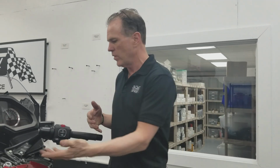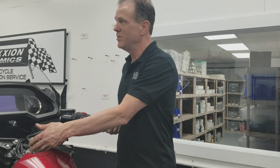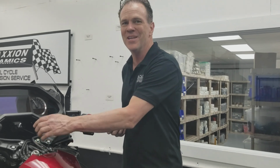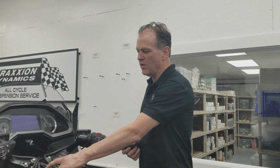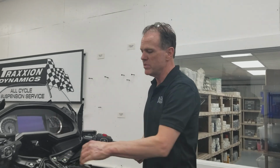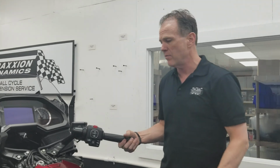Normally, the whole fork and front suspension is transferring all kinds of load and shocks and jars into the bearings, and the torque is twisted there. And so that's why your steering bearings wear and loosen up over time. This bearing will never loosen up or wear out, and I think Honda just Loctited it for that reason.